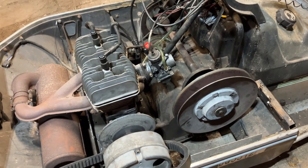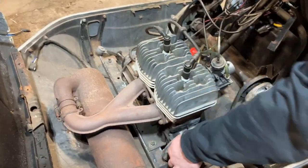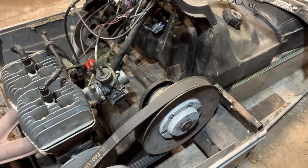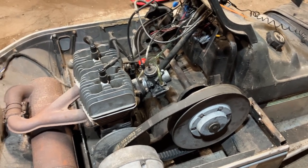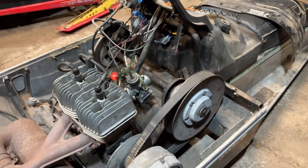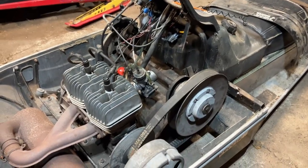That's basically it on some of the basics of clutching measurements. There's a lot more science involved in the weights and springs — that's where we're not experts quite yet. We've done a lot of testing. Learning these basics was huge, because you're looking at these measurements and wondering what the heck they're talking about and all the terminology behind it. This is a very basic layout of how to measure. If you're doing a motor swap or have to remove the engine, just check it before you take it apart. If you can find the specs, you can put it back and check where it should be — maybe it wasn't right in the first place, or you're fighting a problem someone else created.